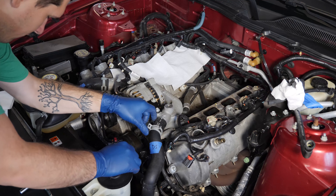These hoses have never been removed — mine clearly haven't — and they will be stuck on very, very tightly. I very carefully took a flat head screwdriver and without marring the tube below, gently worked it underneath and pushed it back a little bit to loosen it. The bottom connection was giving me a ton of trouble, so instead of spending a lot of time on it I just disconnected it from a support below and pushed it out of the way. I also used some small bungee cords to pull the electrical connectors up and away from my working area.